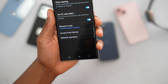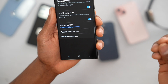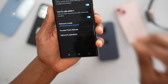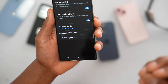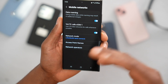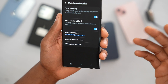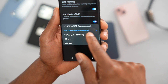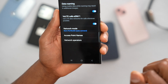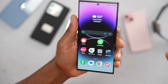The phone is now not allowed to work on 5G. Do that because sometimes the 5G tower nearby may have some issue, and that's why your phone is having signal or internet issues. By selecting LTE only, your phone will work on 4G. Use your phone to see if it's working correctly. If still in problem, go back and change the setting back to 5G/LTE/3G/2G auto connect.